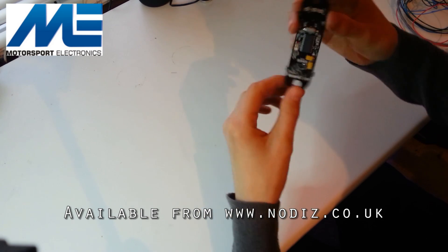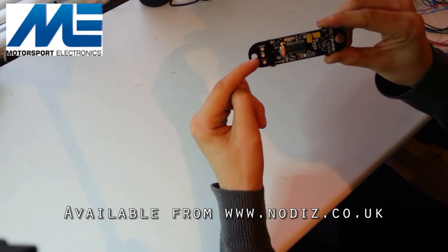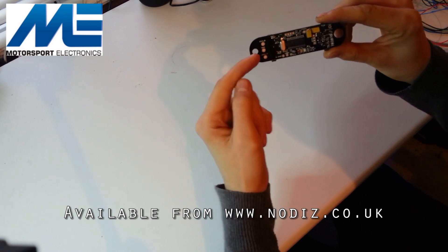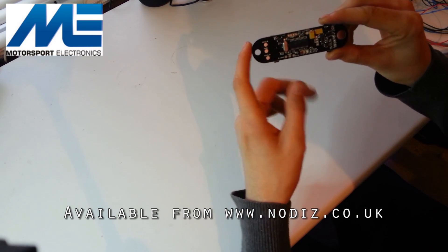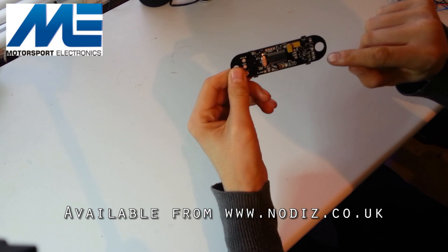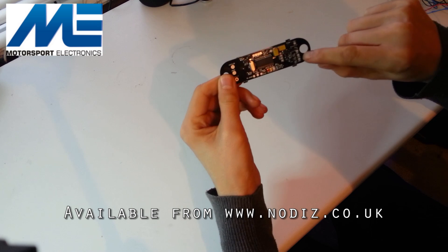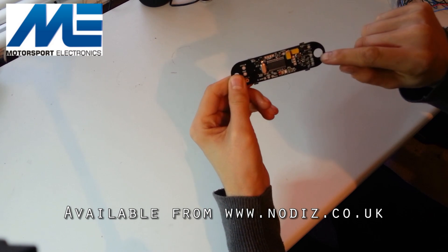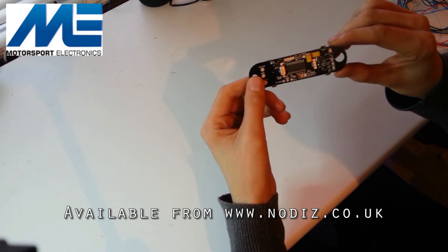In terms of actually wiring these things up, you've got about seven connections to worry about. First of all, you have your coil connections at this end — coil A, coil B, and the ground connection, which is a thick ground connection for the whole unit. At the other end you have your crank position sensor, which is three wires: the positive wire of your VR sensor, the negative wire of your VR sensor, and the shield. Our coaxial wire has a shield wire running down it, so we always earth it locally to the board, which stops any crank position interference.